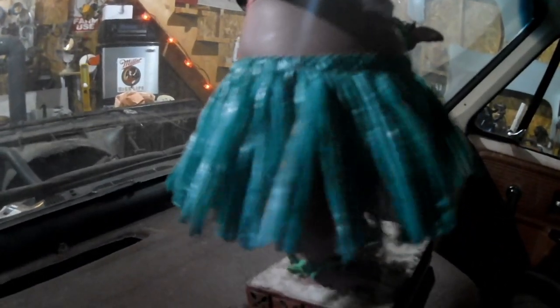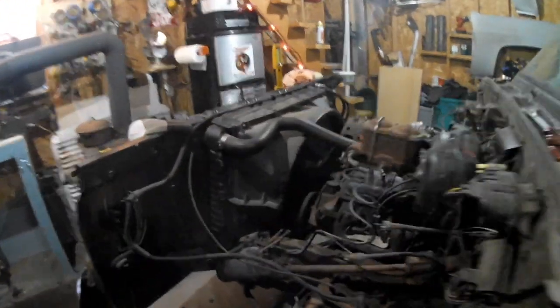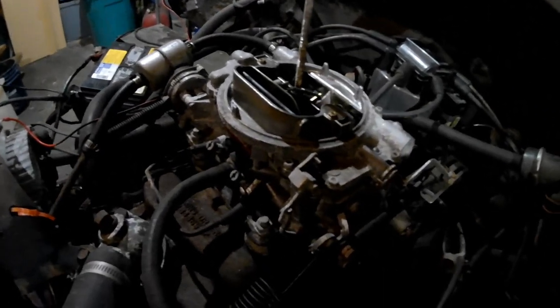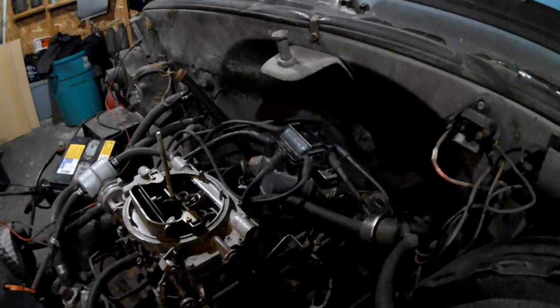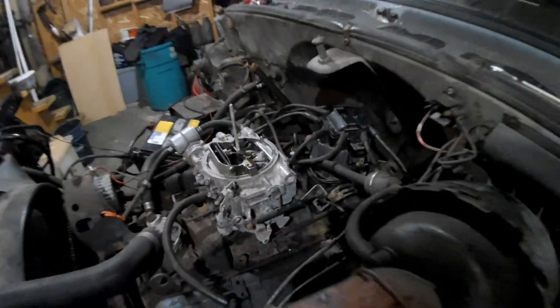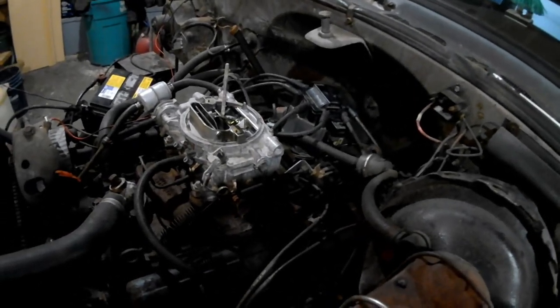Any better? You can really see the misfire. A little shaken. For some reason the choke wouldn't kick down, I don't know what's going on with that, but I got that figured out, calmed it down a little bit, and tightened up the distributor. And my theory was wrong, because it's running exactly the same as it was with the other distributor.